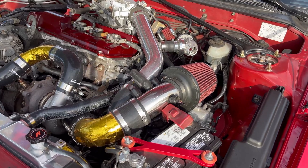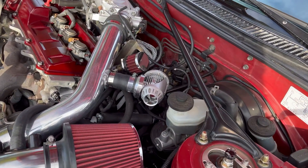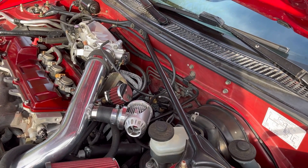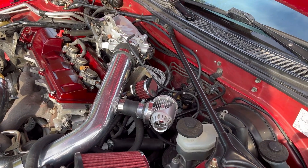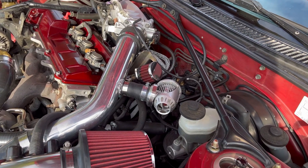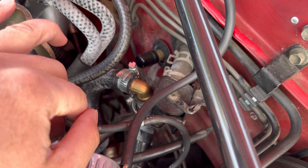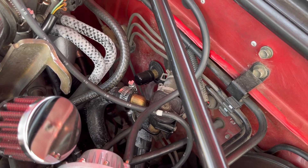At the same time, when I was removing the hoses that transfer coolant into the heater core, I may have damaged the heater core hoses inside the cabin. After a few cruises with my friends I realized the coolant was leaking inside the cabin because it started to smell and fog up my car. So I did a bypass — you can see it here with this yellow elbow adapter — to prevent coolant from leaking into my cabin.